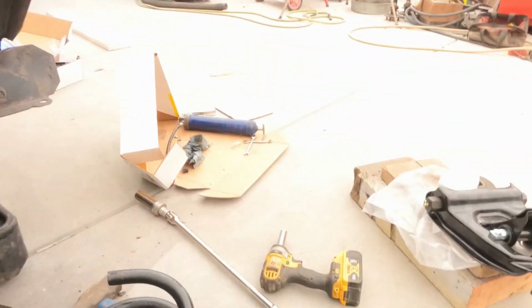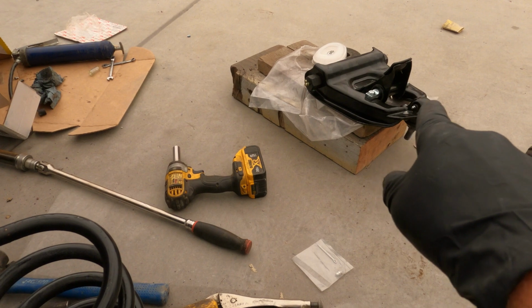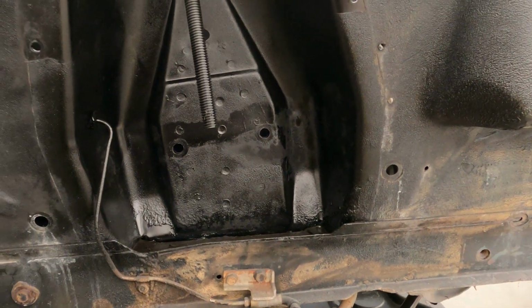And also before you guys throw the control arm on, even though we did throw some 90s in there, it'd be a lot easier to grease it out instead of in the car. So let's get into putting this coil on.